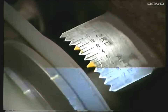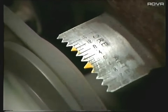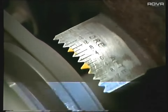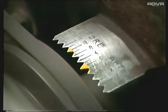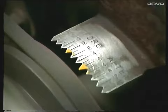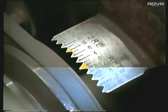With the engine running, we can now start to carry out the engine tune. First of all, with the aid of a timing light, we can set the ignition timing correctly. Just move the distributor around until we get the correct setting, which should be 12 to 14 degrees before top dead centre. We can also check that the mechanical advance is working by bringing the engine revs up and watching the mark on the pulley wheel move across. We can check the vacuum advance by giving a little blip on the throttle and watching the pointer on the pulley wheel move across and then come back again.